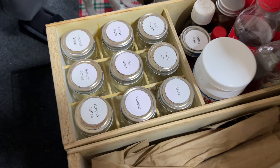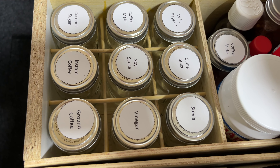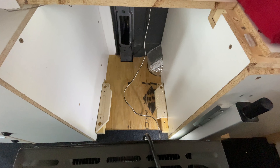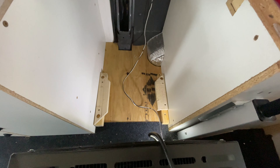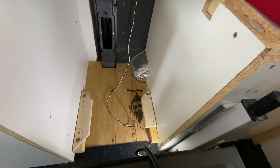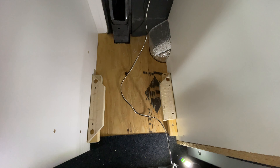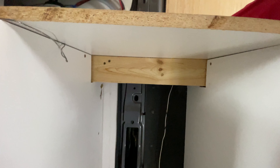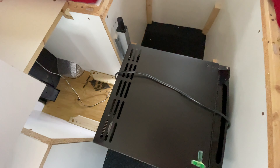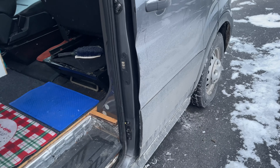Earlier I had so much air coming in around the unbuilt galley. The fridge used to stand on a little square pedestal; I've now converted that so there's airflow underneath, because there's no other source of fresh air to go through the back of the fridge. I'm putting the fridge on two little mounts so air can go in underneath, and above it below the bed will be a place for air to come out of the grill and then flow along and out into the passageway.